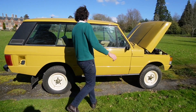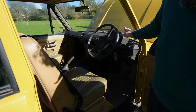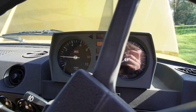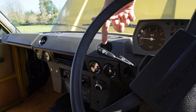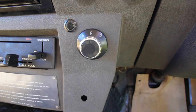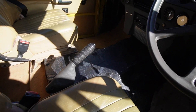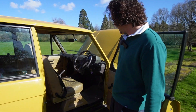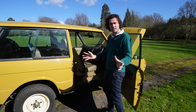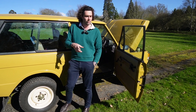Inside, all we've done is put gauges in. In the original binnacle you've got the original indicator lights, plus amp draw and miles per hour. On the other side in the middle you've got battery level and battery temperature, as well as the gear selector just below - obviously because you no longer have a gearbox. It's been Dynamatted over and will be carpeted; the leather will be replaced by the owner. It's not a big iPad on the dash - we like to keep it analogue and fairly original-looking.